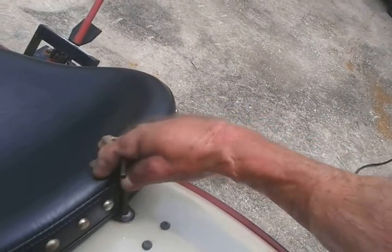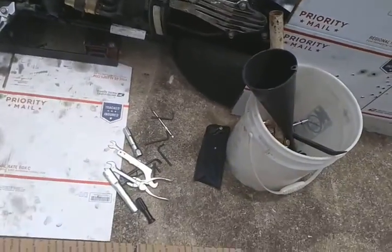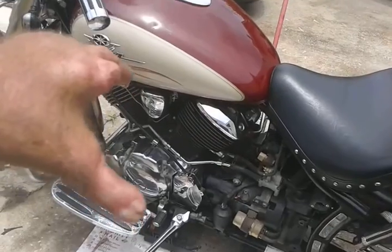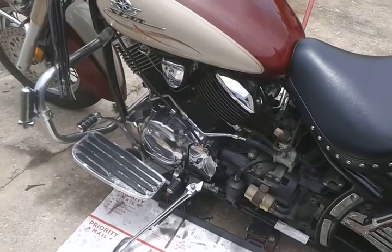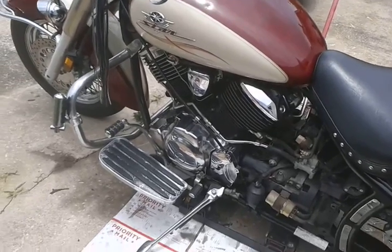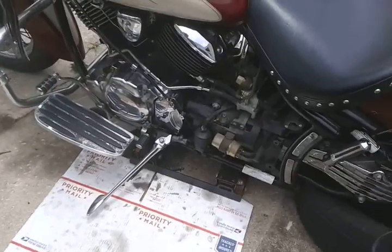Right here you put a five millimeter Allen key. This is the Allen key that came with the motorcycle, and a lot of the tools needed for this job were riding in the bag with the motorcycle. This little bucket right here has an assortment of tools I needed. I'm only going to end up taking this side cover off again and putting in the updated parts I bought off eBay — the updated starter clutch dampener and the updated starter clutch itself, the one-way clutch system with all new bearings.